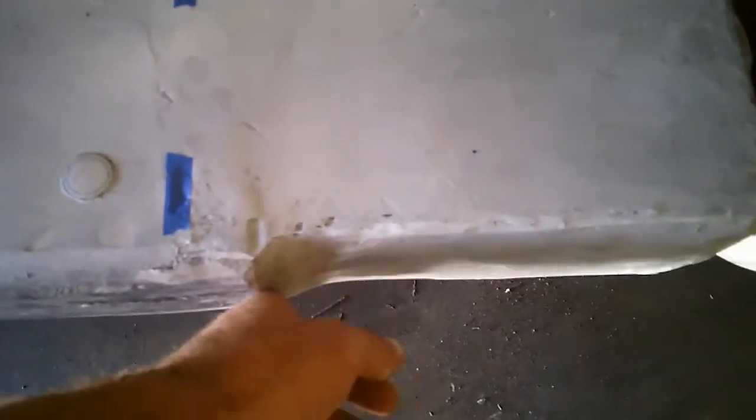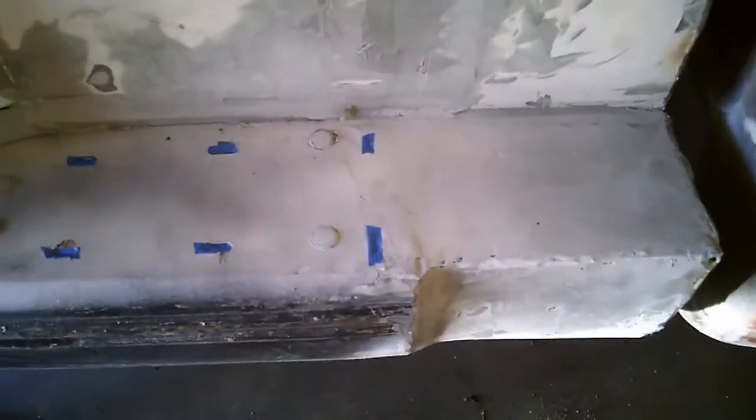This side is gonna take a crap load of work. I went short on my framing so I've got to pull more. Anyway, I'm gonna fill that up. There was some damage up here too - I dimpled them with a ball peen hammer and then put the tape in there to keep the mud from sinking in. Then you just sand it flat.